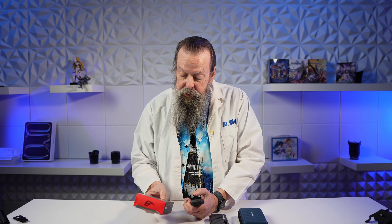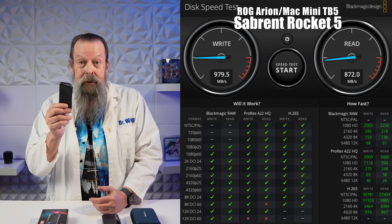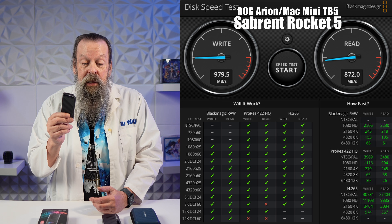Now I'm going to go downstairs and run speed tests, then come back and show you how it went. The next day — disappointed. I thought this would be an easy video: put SSDs in enclosures, run downstairs, run speed tests, come back up. No. It's the next day. I learned a lot about USB and Thunderbolt, which I will now share so you don't have to go through this. First, we can eliminate the ROG right away — don't waste your money. It says USB 3.2 Gen 2 right on the box, which means it's not going to be fast.